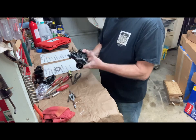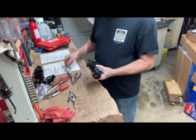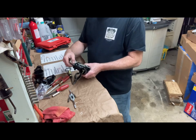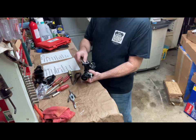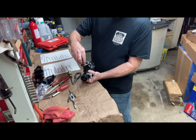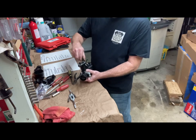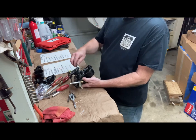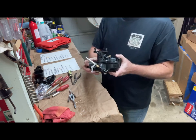So, like I said earlier, the throttle shaft's on back order, which I just reused the old one. Gasket for up top here, and this one, the GAV seat. I didn't need to use it on the Zenith one because it's made into the carburetor. And so I was waiting on the throttle shaft. Oh, and the fuel strainer at this end. I got the washer, but don't have the strainer. So there she is.